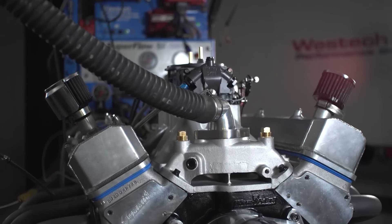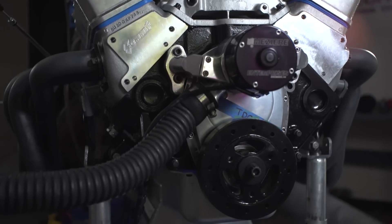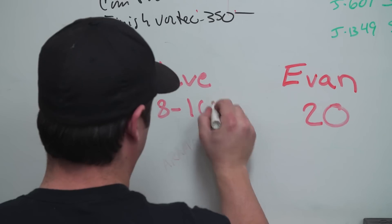We're going to keep the water temperature exactly the same, the oil temperature exactly the same. We're going to keep every parameter as close as we can. So what's your guess — how much are you guessing we're going to pick up? You know, that's what's so cool about this. I really don't know. This is so much different than let's change an intake manifold, let's change a cam, let's put a bigger cylinder head on it. This is a test that I've never done. My guess is 8 to 10 — I'm going to say 8-ish.